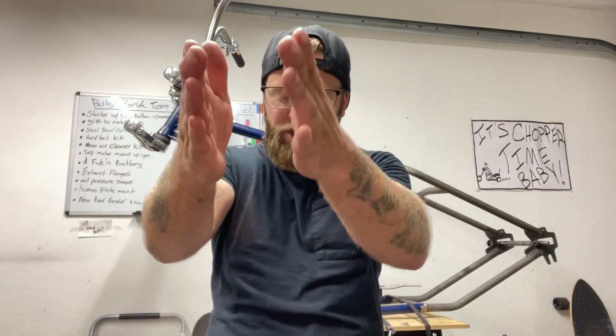But first, the rear tail section alignment is so important to be straight with the rest of the frame because you don't want the front of the frame to be center and then have the back of the frame be tilted to the left, tilted to the right, or up or down, throwing off the angle, because then the bike's gonna veer this way, the bike's gonna veer that way. And when you measure your rear wheel adjustment when you are putting your rear tire on, then your rear wheel is going to be off from the rest of the frame if your actual rear section of the frame is off, and it's just going to mess everything up. So make it straight. Ish. Nothing's perfect, except for my dance moves.